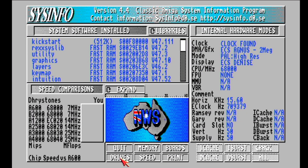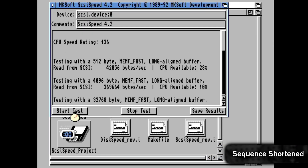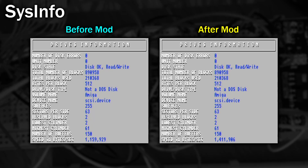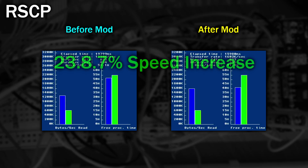So with all the modding done, it's time to check the results. I'm going to run them exactly as I did before and we'll take a look at the results at the end. Starting with Sysinfo, then the raw speed controller test, and finally disk speed. Let's compare them side by side. First up we have Sysinfo, and the most important part is the speed in bytes per second — Sysinfo shows this mod giving an extra 21.7% speed increase, excellent. Now on to the raw speed controller test — this reports a just under 24% speed increase. It's worth noting however that the amount of free processor time decreases, so the extra speed comes with a little bit of CPU overhead.